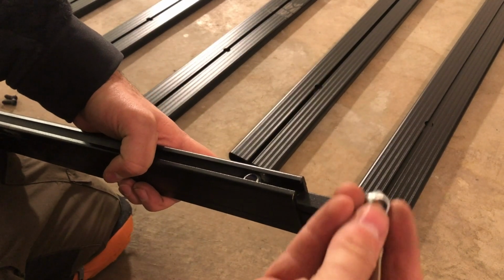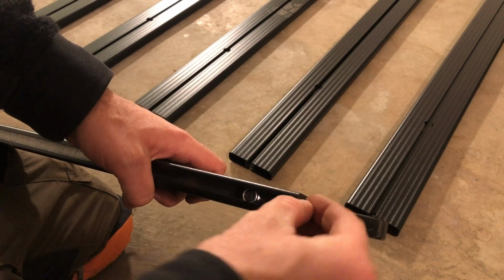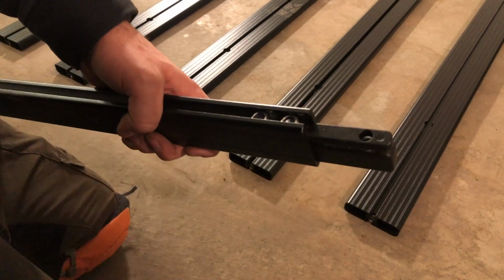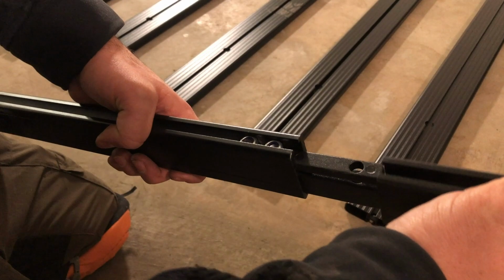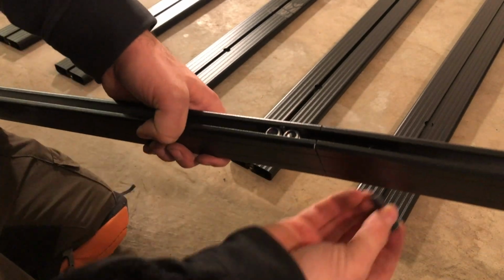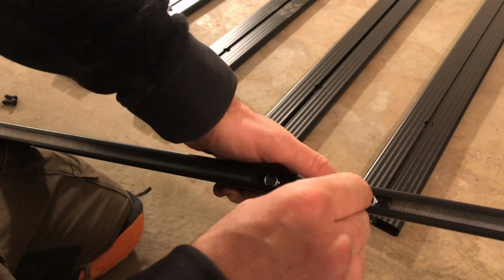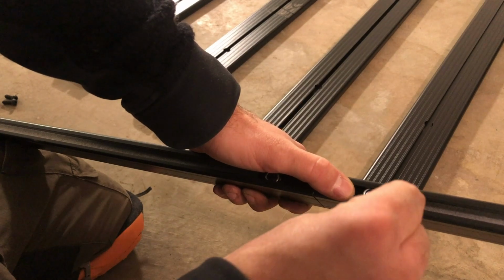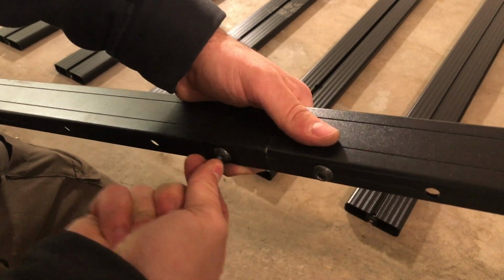Before connecting either the long side or short side profile, depending on which side you start on, be sure to thread another nylon nut down the channel on the side profile. You attach the thick and thin joiners first before connecting the side profiles together. Take that exact same bolt used earlier and thread it through the joiner hole, through the thick and thin joiner, for the nylon nut to catch the other end of the bolt. Go ahead and repeat these steps on the other side.